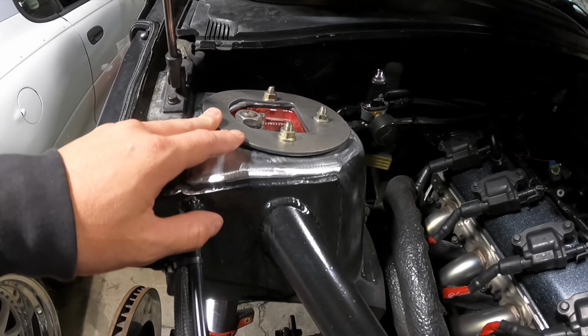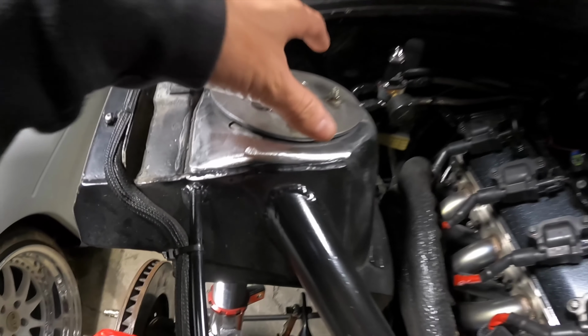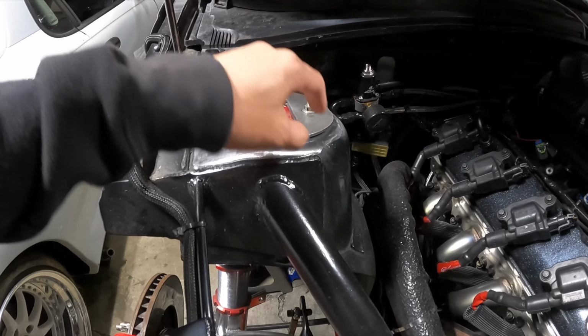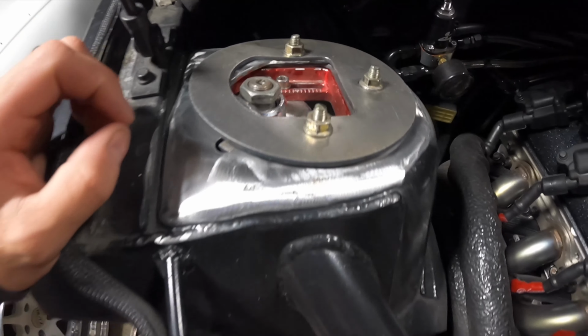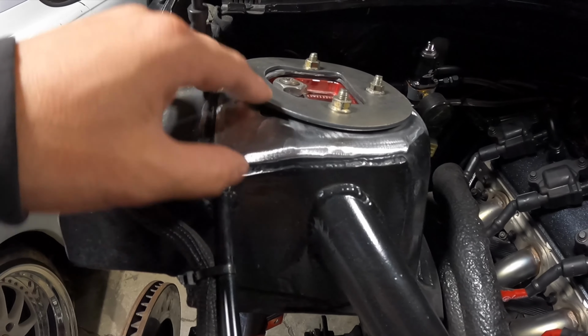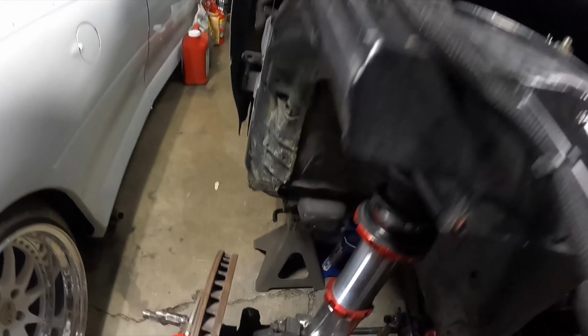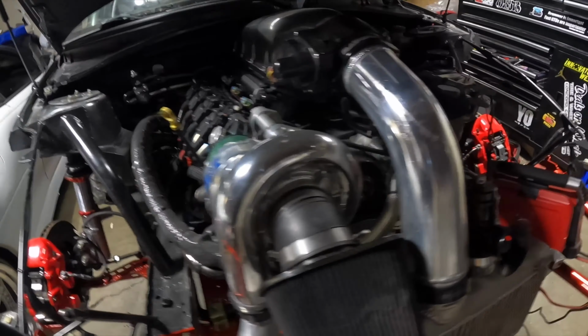Obviously, after it gets aligned, I want to make sure I have enough movement in the shock tower before I weld it in there. I'm going to tack weld it, clean up in there so it looks nice and clean, and shape it, put a C-clamp on, pull it down, weld that. The bottom looks pretty good. So thanks to Marcus Fry on those.